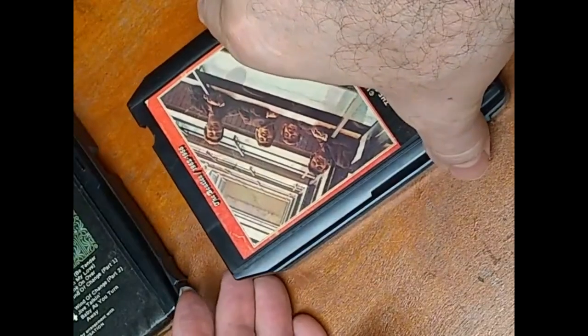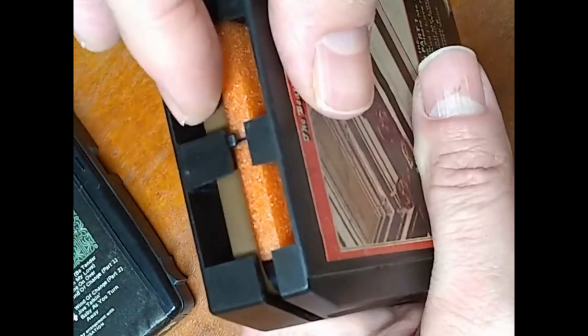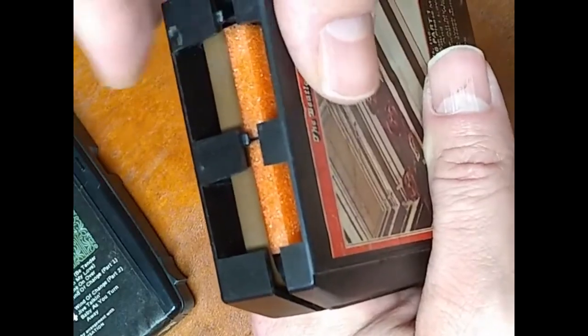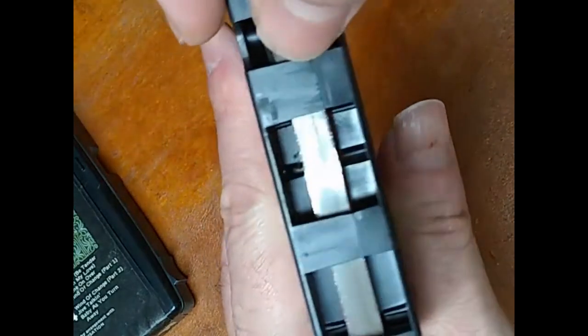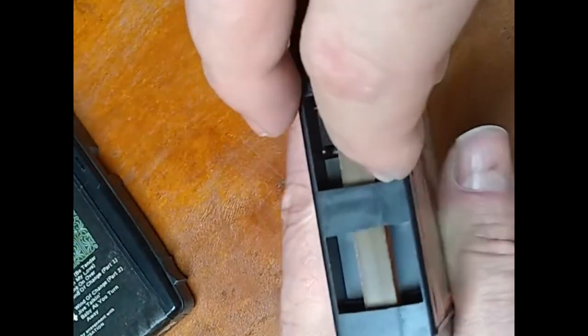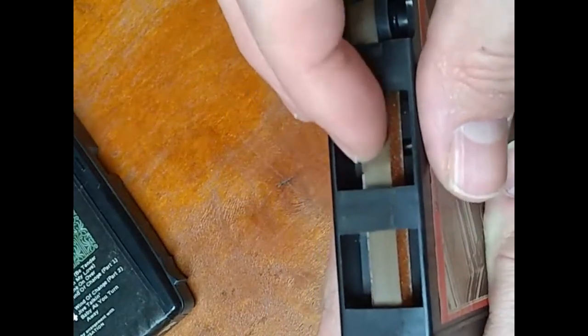When you put this cart back together, before you close the top, you can see the tape's getting stuck on the pad. You have to push the tape towards the front or towards the back part of the bottom shell. Then make sure everything looks good — the pad's going underneath the tape and it's not going to hit anything. Then you can snap it back together. This has a tendency to get pinched right here at this tab if you don't do it just right.